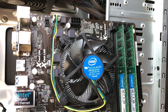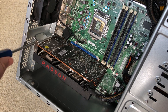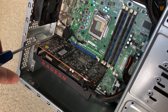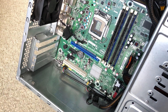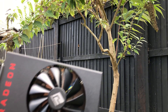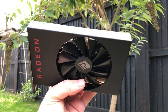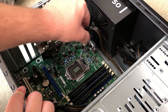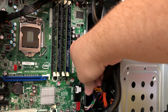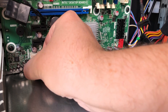Swapping out a motherboard bundle can be more inconvenient than building a new system sometimes if your cables are managed in a specific way to suit the previous board, like they are here. Nonetheless, the first step will always be the same — removing the graphics card first is the only way to go, and detaching the power cable from it is a must. The RX 5500 XT is one of my favorite budget gaming cards at the moment, and for my sister's needs — playing The Sims — it does just fine. Next, disconnect all power cables from the PSU to the motherboard, as well as any cables from the case, such as USB, audio, and front panel cables. Any system fans will need to be unplugged too.